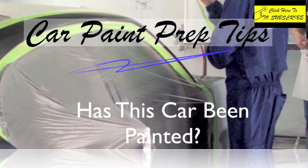Again, has this car been painted? And we're talking about masking. One of the easiest indications to determine if a car's been painted is by the way it was masked. And you don't have to be a trained professional to see this. If you see a jamb that has a real hard edge on it, or around some of your moldings have overspray or primer or paint on them, anybody can see that. So it's a very easy way to determine if a car's been painted.